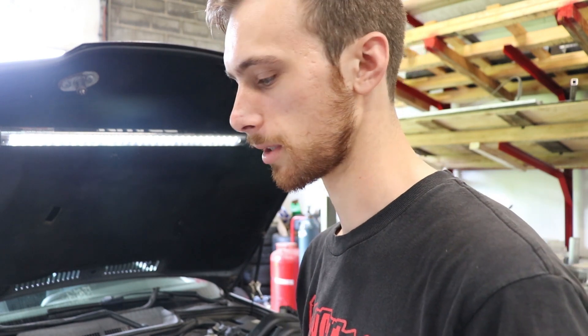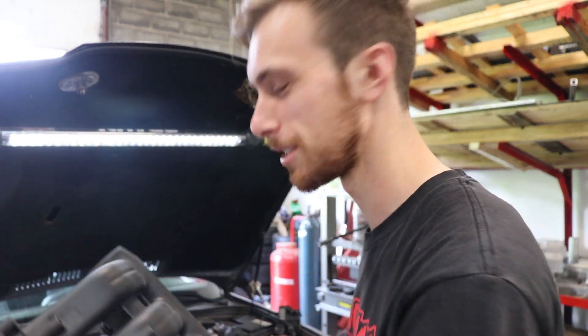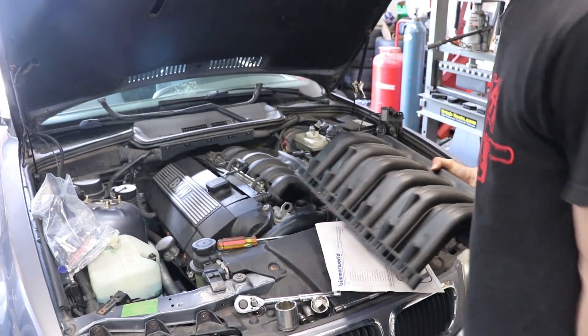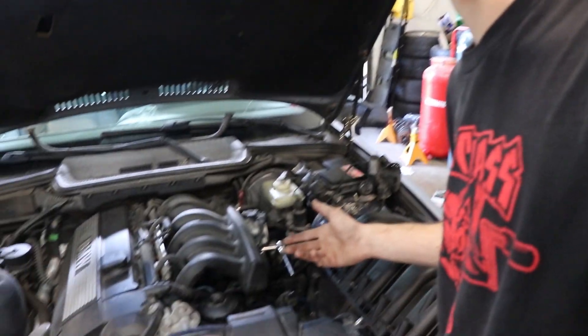It's not really too bad — there's one bolt in the back that's really hard to get off. I got the M50 manifold from the junkyard so I've taken one off before, but I've never had the car run afterwards, so this should be pretty interesting. If you're new to why we would do this — the intake runners on the M50 manifold are quite a bit larger. I think I read it's 40% better flow, not sure if that's true, but I'm trying to add a little power with this and some intake stuff to get more air into the motor — more air, more power.